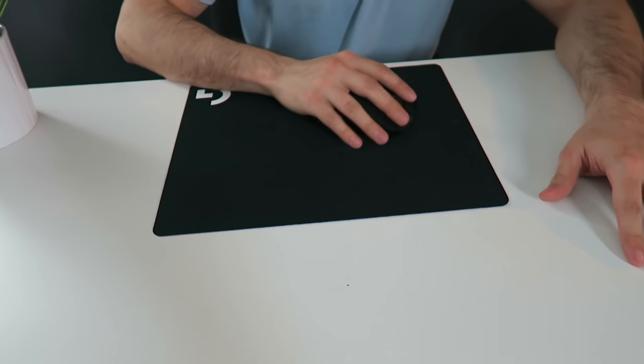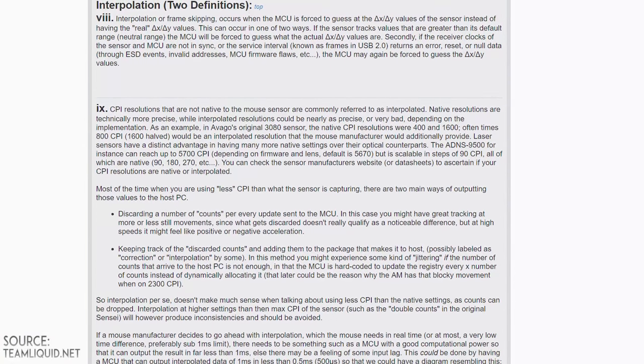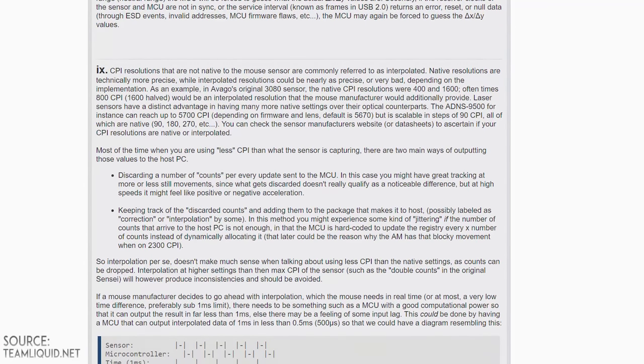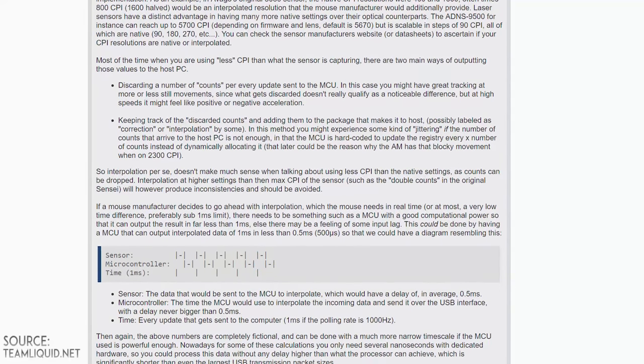Training your muscle memory to adapt to uncertainties or differences in tracking depending on speed can be sub-optimal. For most, it's easier to aim and have the best precision when — no matter how fast or slow you're moving your mouse — the corresponding cursor movement on your screen is the same, with only the change of position determining the cursor's movement. One more point about max DPI: it has nothing to do with accuracy and precision. Practically, 12,000 DPI to move an inch across 11 HD 1080p monitors just isn't useful. And if the sensor uses interpolation, subdividing pixels can lead to signal noise and tracking inaccuracy depending on the strength of the image processing.